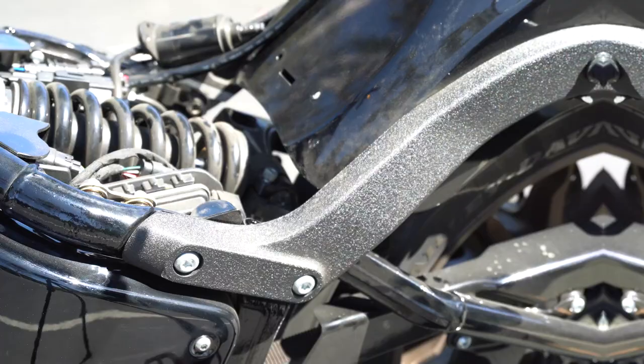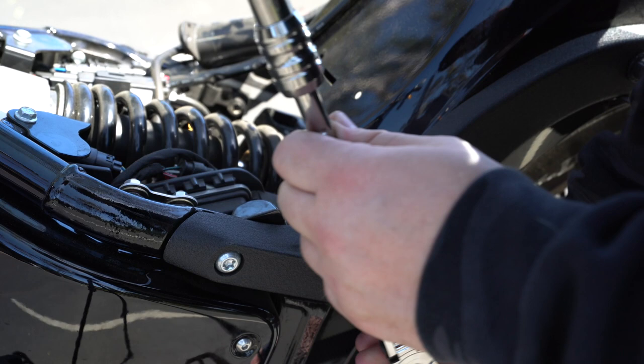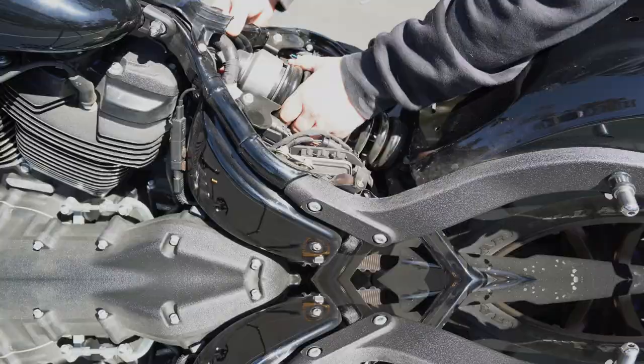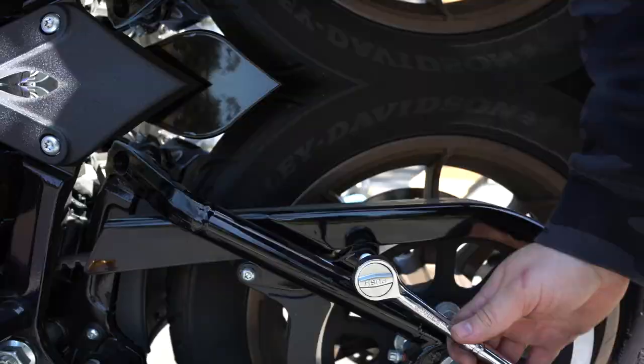Next, you can remove the bottom bolt. Now, there's a fastener at the top that holds it into place — make sure you loosen this first before you try to remove the bolt. Otherwise, you'll end up snapping your Torx bit before it even comes loose. After you've got the rear bolt out, go ahead and remove the top bolt and then you can take out the factory shock. It's kind of tricky to wiggle it into the right spot, but just have some patience. Don't try to force it too much and it should come out relatively easily.